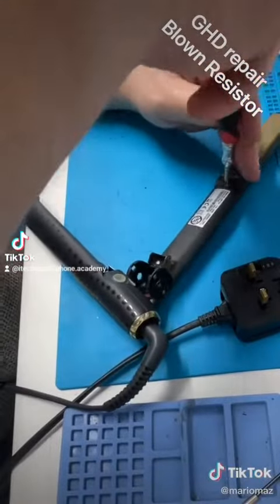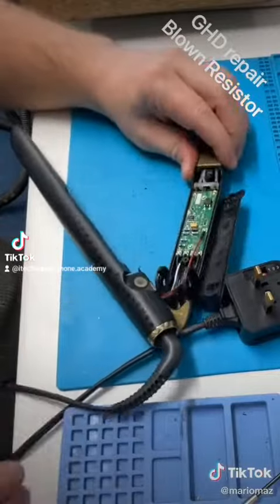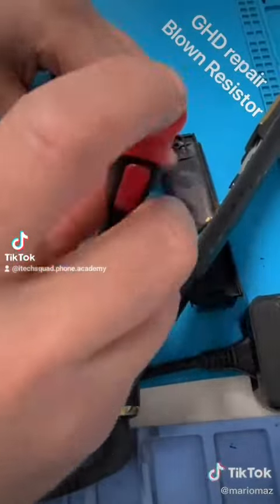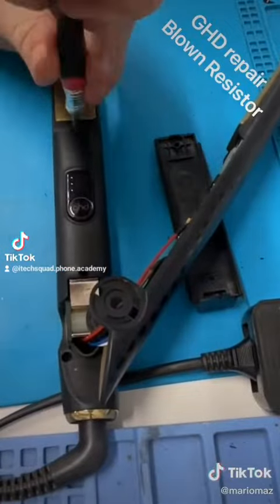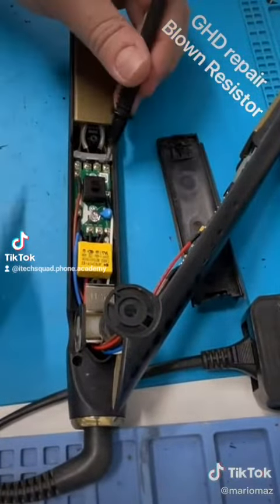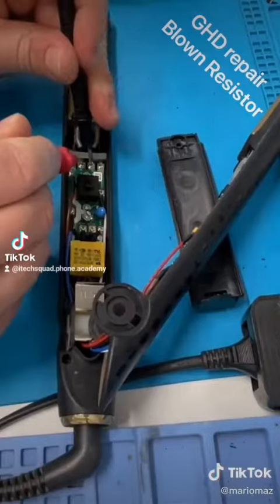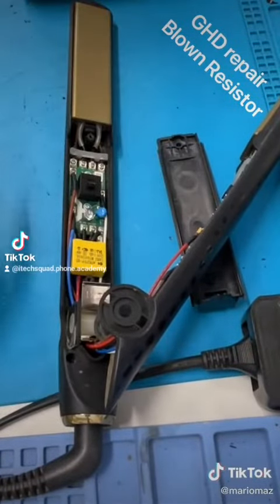Primarily on these, what tends to go is one of the resistors. With all of the GHD series below the Golden Platinum, you have the R8 and R11s, which tend to be a 50 ohm resistor. On some models it might just be the one resistor, which is a 100 ohm resistor. Here I'm just testing continuity on the fuse, which seems good, and checking the ohms on the heaters as well.